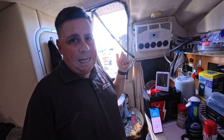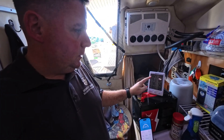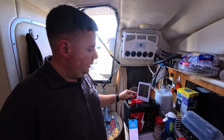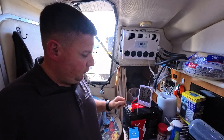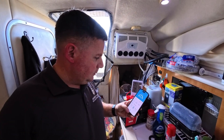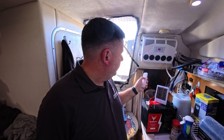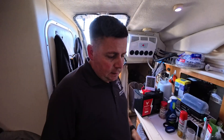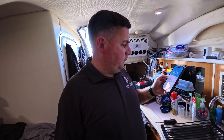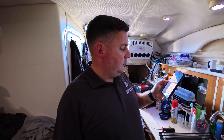Next day — 89 degrees outside. The thermostat in the window reads something high, but it's 91 in the engine compartment, 98 in the head, and 94 degrees in the boat. The battery is at 100% this time. I'm setting it on manual, fan at four, 10 degrees Celsius. In about 30 minutes it should be 74 degrees. Quick look: it says 75 amps, almost 1,000 watts, and one hour 24 minutes of use — so let's see how it performs now that it's actually been fully charged.